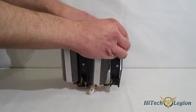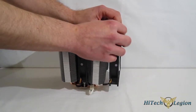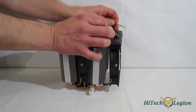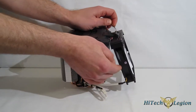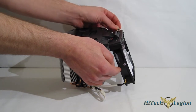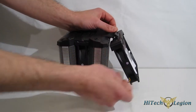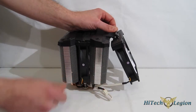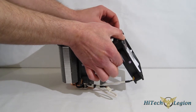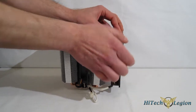Interestingly, the front fan has a pin which can be unscrewed and taken out — it locks the fan into place. The fan can then be tilted and locked so that it is blowing down rather than through the cooler itself. This gets airflow going around your VRM for better overclocking in the VRM department. Of course, you will lose a little airflow through the cooler doing that, but you'll be able to cool the surrounding components a bit better.